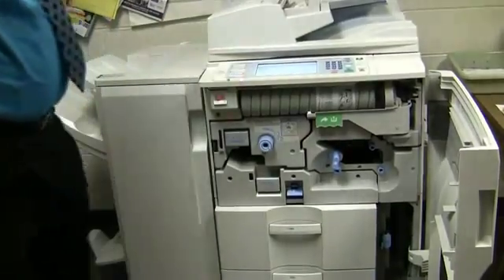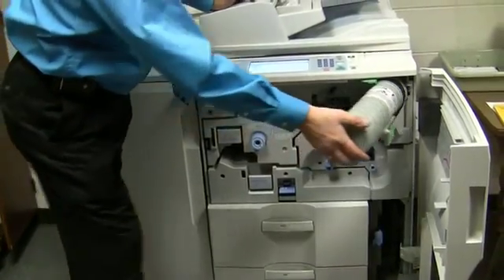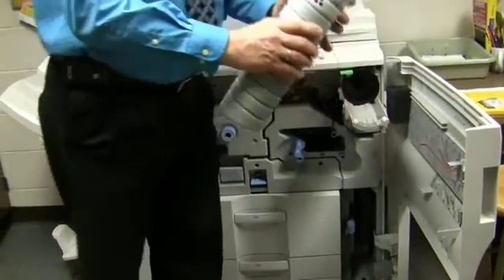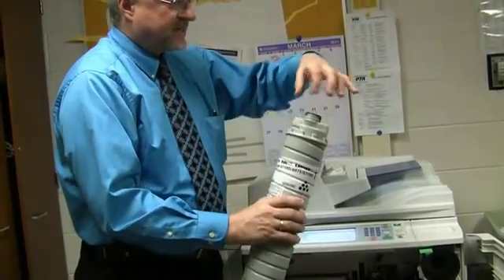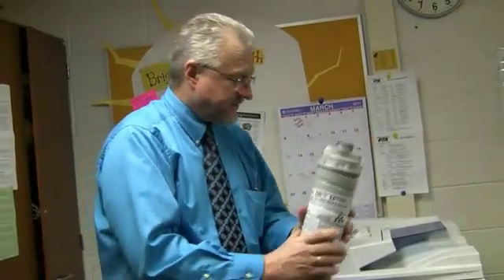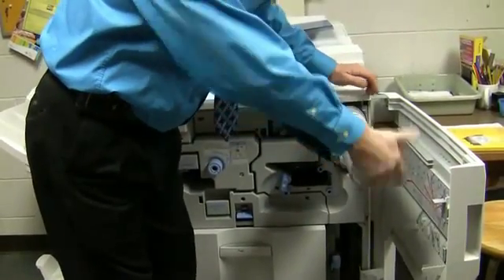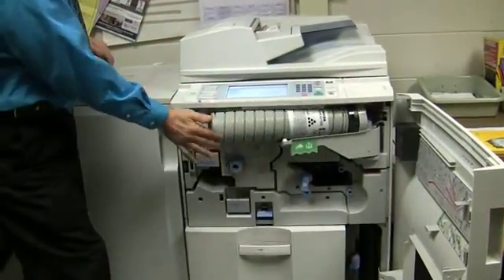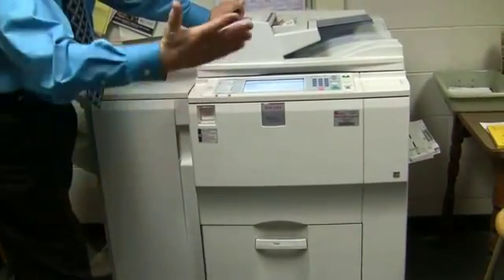Now, last is your toner. This is your toner cartridge right here — this opens up like so. All you do is lift this green tab up and this whole bottle comes right out. Now when you get the new one, it's going to have a little black cap up here. What I suggest is, while the cap's on, shake this thing up pretty good because it just settles during shipment. Take the cap off, put this in here, and just twist it a little bit to hear it click. Don't turn this all the way around because if you do, you're going to break the mechanism in here and it won't work properly. Just close it, and the door just closes like so. And basically, that's your machine.